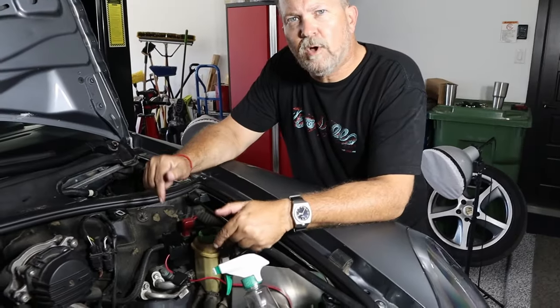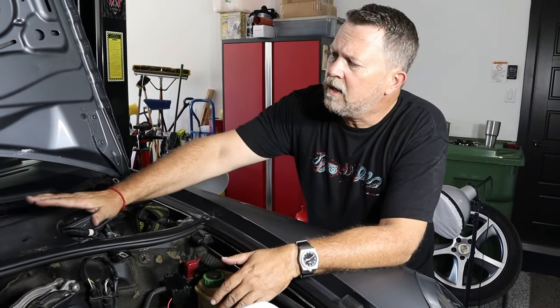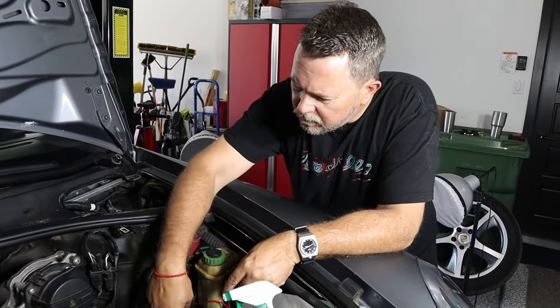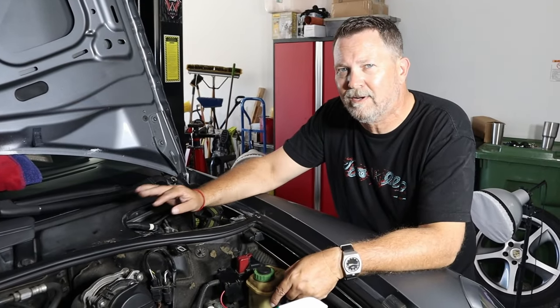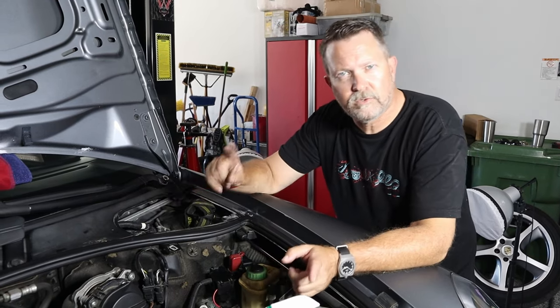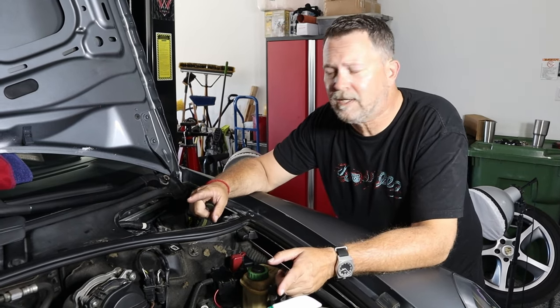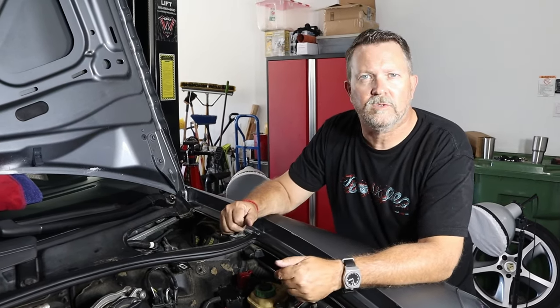We're supporting the strut and need to remove three bolts inside the fender to get this control part off — one here, one approximately here, and one buried in here. We tried to bend the panel back, but it's just too old, so we've decided to pull off the windshield wipers. Rob's going to show us a trick to line them back up again. That's a 16-millimeter socket.